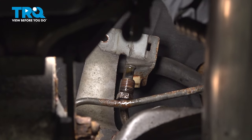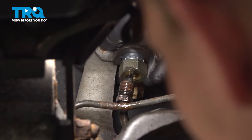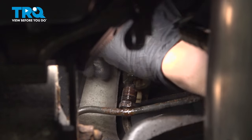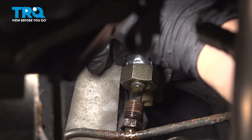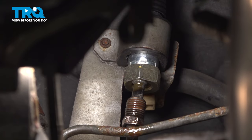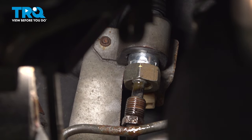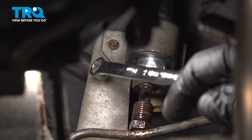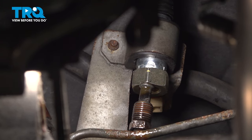Install the new line. Install the bracket — now we're going to put our 10 millimeter bolt in the back, push it towards and then up through the back, get it started by hand. Using a wrench, snug it down. Push on the face of the bracket right here to tighten it down as you screw the bolt in.